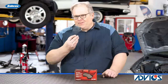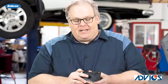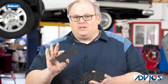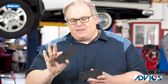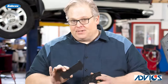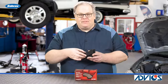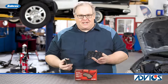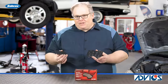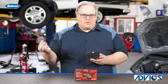So how do you decide if this brake pad is high quality? Well, you look at the shim. If you can remove the shim with your hand, this is a sign it's a free-floating shim, and it's held to the back of the backing plate with these fingers that are essentially springs. If this shim was attached with adhesive, it's not going to do a very good job at preventing excitation of the caliper and the rest of the suspension. So if you buy a high-quality brake pad, look for the shims and if they can be removed just with your hand.